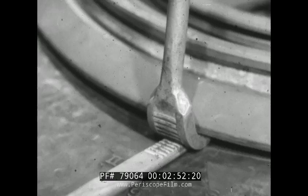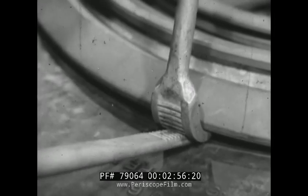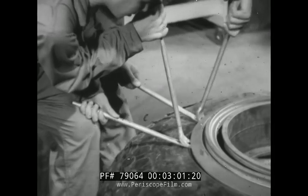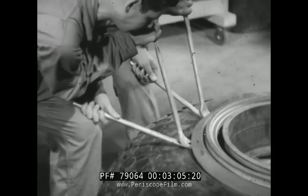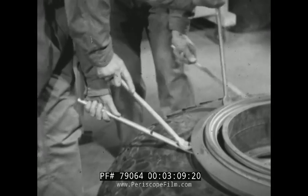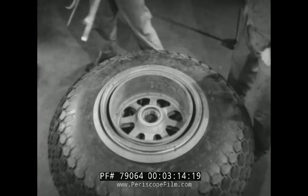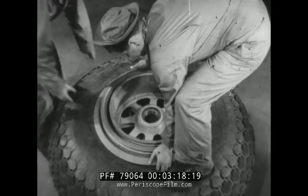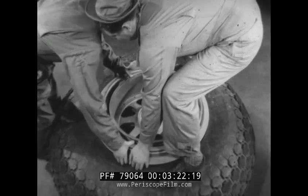The claw unit of the Kennedy tool is inserted under the rim flange so that it engages the straight tool. Position is taken to use knee leverage to lift up on the straight tool while at the same time the claw tool is pulled down. Loosening the tire bead with two Kennedy irons is made easy by teamwork. The demountable flange may now be lifted off and set aside out of the way.